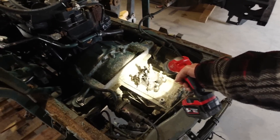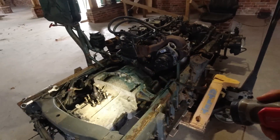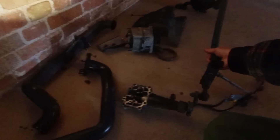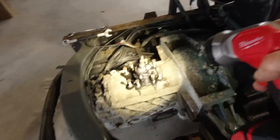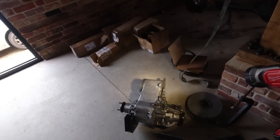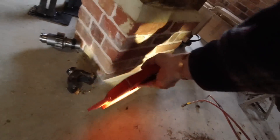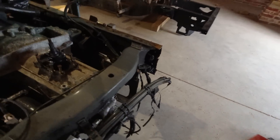Rhys Myers supplied me with this gear stick selector. This is the gear selector that was the lorry one - that's the ball that needs to be put onto the new one. He also supplied a plate that's going to bolt to the back of the gearbox, and then the Land Rover LT230 transfer box bolts to this plate - so it goes straight on there.